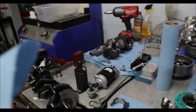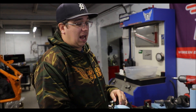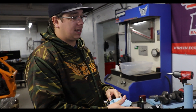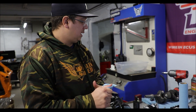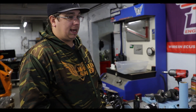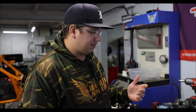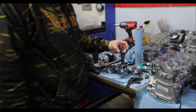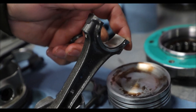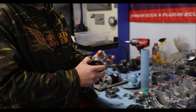We're going to switch it over to a non-D-lock, just a normal straight snap. This crank had a little bit of welding going on, but we're gonna do a stroker. Because we're doing this so quickly, we don't have great piston options for stock bore — we're basically just gonna put a piston-rod combo with a crankshaft in this thing, plus a ported head with some camshafts and maybe a valve spring kit. It will be a little higher compression but within reason. The main point is this is the same exact connecting rod used in the Can-Am X3 — the 743 rod — and these rods are pretty strong.